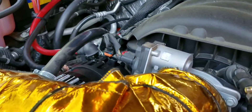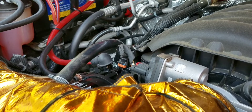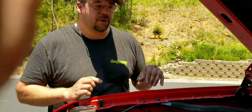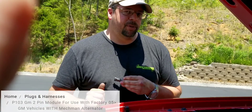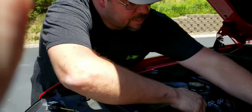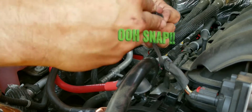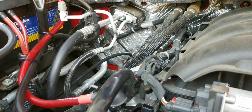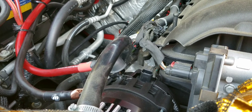Once you have that, you'll have it all plugged in, and you're like: well, I don't want a check battery light, I don't want a check charging light, I don't want any battery lights at all in my nice new truck — and some people don't care about that, we understand that. Well, what we have is a little trickery device that we've come up with that makes the computer think everything is just fine. What you would do with your 4-pin is simply install this and just zip tie it out of the way, because it's not going to be used, and then you would simply have your 4-pin running as basically a standalone system, so the alternator would be its own entity.